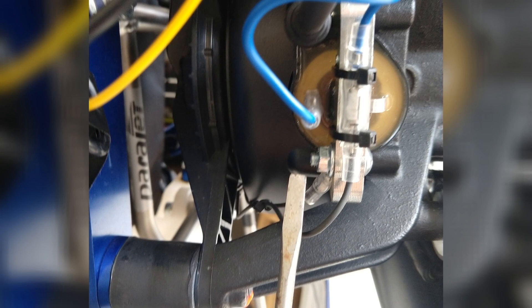There are a couple of places where you can connect that ground from the Viterazzi throttle and lead it to the ignition coil. There are some bullet connectors here — you just get rid of the one that has the spark arrester, and the red one is the ground. You splice in a connector and connect it there to lead to the ignition coil. Or I thought, why not just go directly to the ignition coil and skip all those connectors that could potentially fail? Well, there was a problem I didn't foresee.